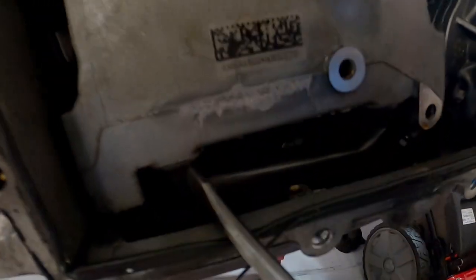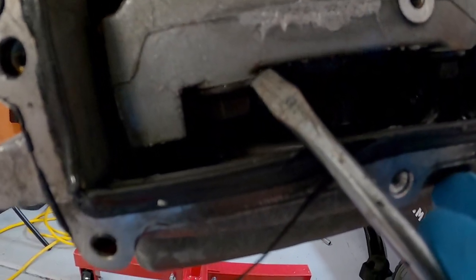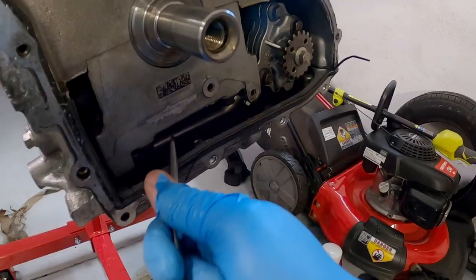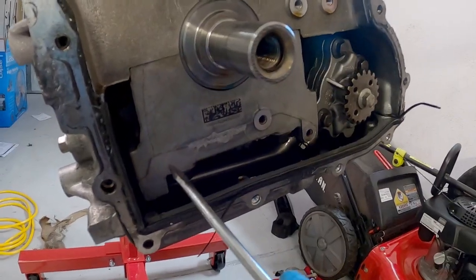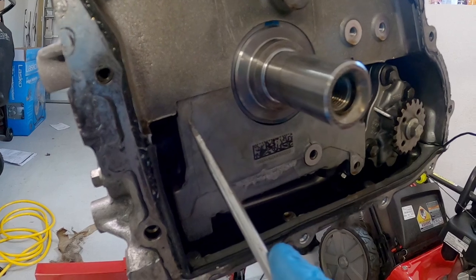I didn't get that far before I found something even more interesting. I took a picture with my phone so you can see it better. Right here where the main cap bolt is, there is a hairline crack going here, up to this rough part. There's a hairline crack that goes from the bolt up there. That means either it was over-tightened during initial assembly or it's a bad casting — because I have no way of touching that; this is the first time it's all been apart. And then there's of course the first crack I found on this front bearing cap. We're going to keep digging.